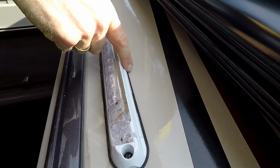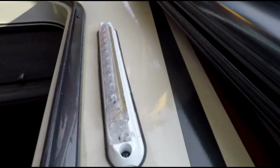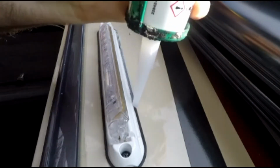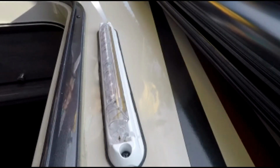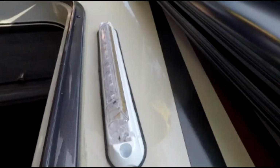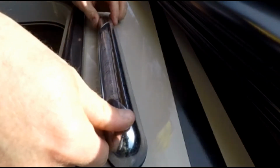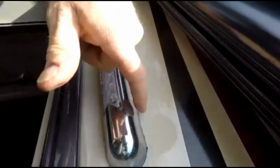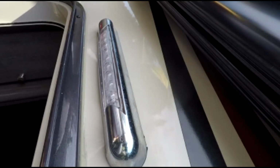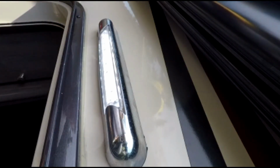And I think I'm probably going to do a bead of caulking above the top there. Just a really thin coating along the top here, just so nothing can get in behind. And we'll fill up the screw holes. I'm going to use the old cover. It's already tarnished a bit, so I might as well save the other one. When this one gets really tarnished, I'll just switch them out. There, done. I'll come back later once the silicone dries and do another one just over the top of this cover, and that should keep all the water out. And one last test. There we go. Should be good for another 2 or 3 months.